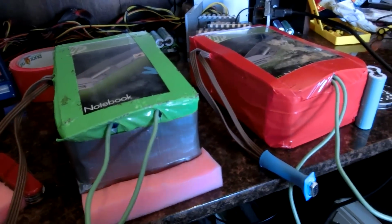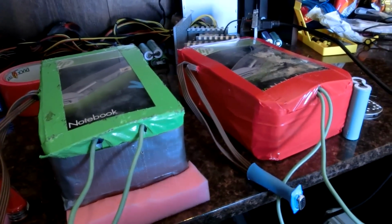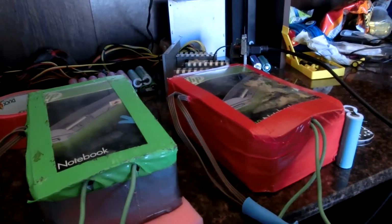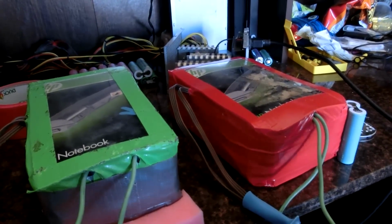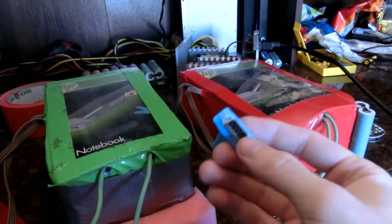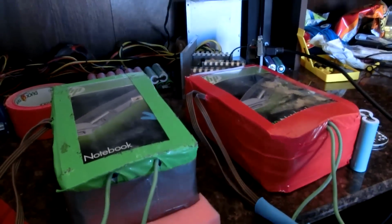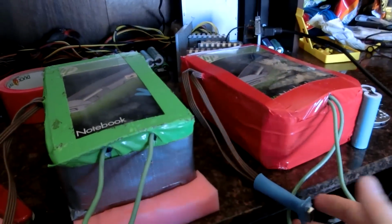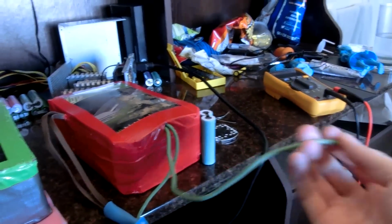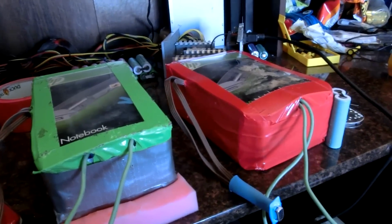Well, it all started whenever the voltage went really low. Normally, whenever the voltage would go really low, I would suspect that an entire parallel pack had shorted out and miraculously didn't blow up. Unfortunately, though, it confused me because the balance leads still showed that each pack was charging fine. You know, because if an entire pack was shorted out, chances are this would not show it to be working fine, or the battery wouldn't work. But it happened to break in the perfect place to cause it to still work kind of, but confuse me.